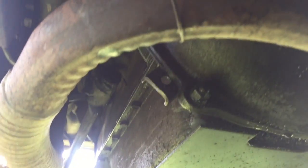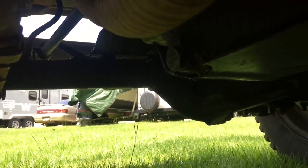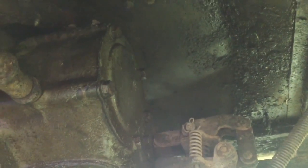Oil pan's leaking everywhere, leaking out the side, leaking out the bell housing, so the rear main is probably bad. Springs look good. Got our knuckles — the usual stuff, it all just has to be redone and rebuilt. But that transfer case — that's an interesting thing. Can't wait to pull that and look at it in more detail.